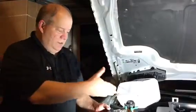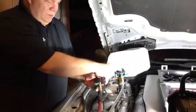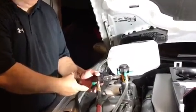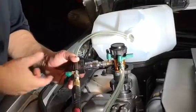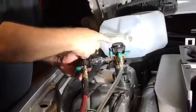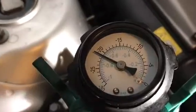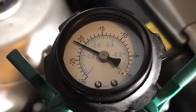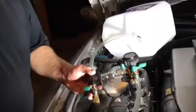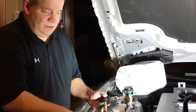Okay, I just finished putting the venturi system. I connect the venturi to the valve, I connect the air line to the venturi. Right now it's closed, and this one is closed because I already opened this, let the air go in, create a vacuum, and put 20 pounds into it. Look at it. I mean, put it like 21 actually. As you can see, I already have like 3 minutes in there and it has not moved the needle, which indicates that there is no leak anywhere. So I close the venturi valve and I close the air hose.